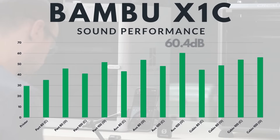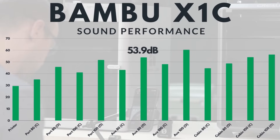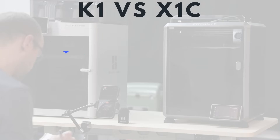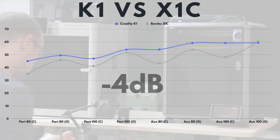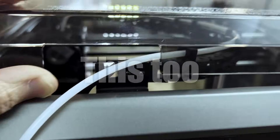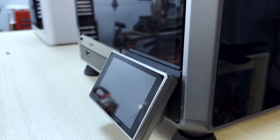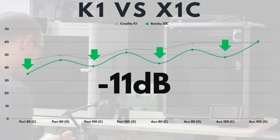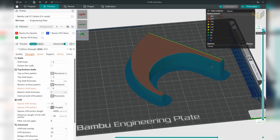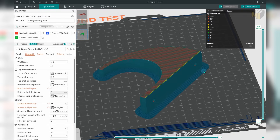The auxiliary fan on the Bambu came in at the highest at 60.4 dB, but down at 80% it was quite a bit quieter, unlike the Creality. On the other hand, the cabin fan was a lot louder on the Creality. The Creality printer on average has louder fans and also doesn't see as big an advantage when the door is closed. Excluding the cabin fan, we only see a 4 dB decrease for the closed printer, and I think the large gap in the door and the open cabin fan at the back are the main reasons for this. There is a model available for filling the void in the door — I will link that below. On the other side, the Bambu printer excluding the cabin fan has an 11 dB average drop in sound levels when the door is closed. I needed a print with long fast moves and infill, so I designed this heavy duty hook positioned on the build plate at an angle — apparently this orientation causes the most motor noise.